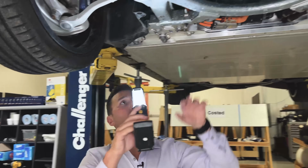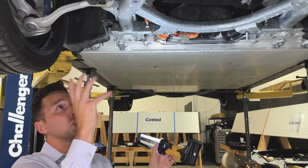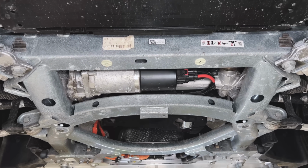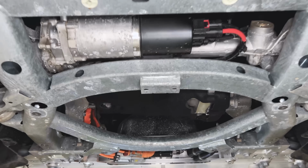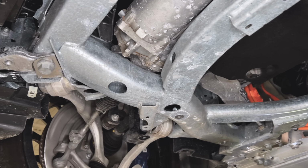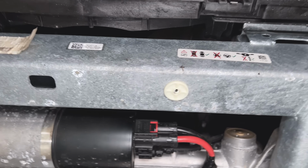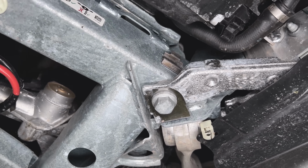As we move inboard, we've got a primarily stamped and tube steel MIG welded cradle. An interesting thing about the cradle, not that it's steel, because a lot of the BMW applications, specifically the smaller segments like the 3 Series, have steel, but this is galvanized steel. Ordinarily we would see E-coated or a black subframe or cradle. In this case, they went with a galvanized setup.